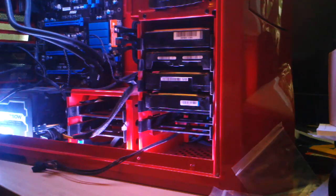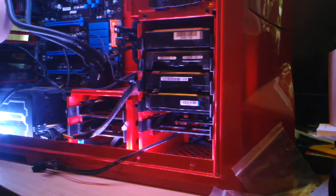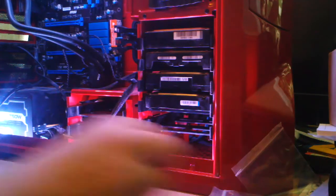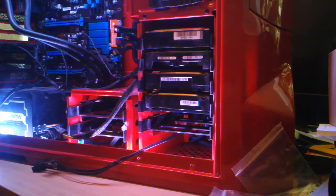Right, yeah. There's a screw over in that top corner. The good thing is, on ATX motherboards, which is what this is, full ATX, all the screws are in the same place. Same as on a micro ATX, and EATX, and possibly XL ATX. I'm not sure about that one though. I've never had an XL ATX motherboard, so don't quote me on that. I would think it is, as it conforms to the ATX standard. I would think the majority of screws are in the same place, same as on the EATX, because then the EATX goes over here, and an XL ATX, I think it comes over here and goes down a bit further as well. So this is the boring part of putting all the screws in.